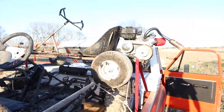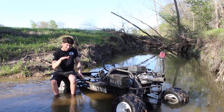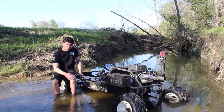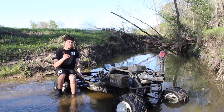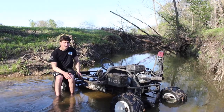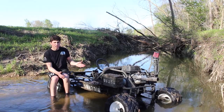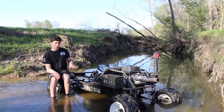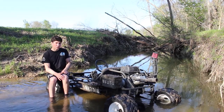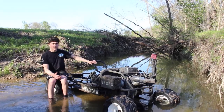Stay tuned for this. Alright guys, thanks for watching. I wish we could end it driving away into the sunset, but it doesn't want to start right now, like at all. Well, it starts and it'll run kind of, but it keeps backfiring out of the intake and shutting off. I don't think we hydro-locked it at all. If anything's messed up, it could be ignition. I don't know. Or it's just really angry right now. But we've been cranking over for the last 20 minutes and we can't get anything out of it. We can just get it to sputter and then it backfires out of the intake and dies.